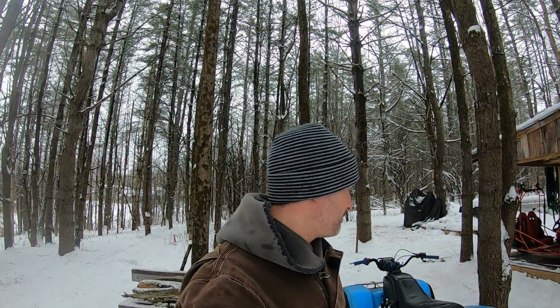Super smooth, really great. So for all that work, soaking it in Berryman's, cleaning, doing the jets, really got a great tune-up out of it. But I did miss on cleaning out the fuel delivery. I assumed soaking it in Berryman's and then shaking it in some water would do enough. It didn't do enough. So, finally figured it out.